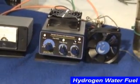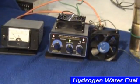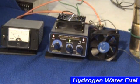When the unit cools down, the PWM will return to normal operation. The indicator light, located above the temperature light, will turn green. The 12 volts supplied to the back of the unit will also automatically be switched off, and the hydrogen production will be restored to normal.